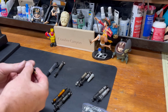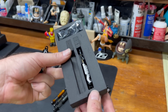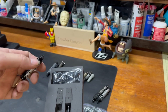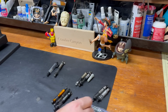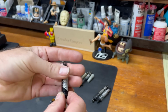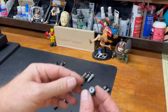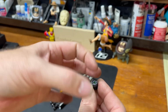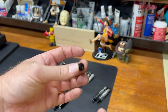And where does that Desert Lizard fall? The Desert Lizard is a shock that, when you buy the shock in the little package, comes with all the springs and all the different levels of pistons. The versatility of those pistons, we won't address that because they come pre-assembled. So the seal packs are pre-assembled under here. They're pretty easy to take apart. You see a little split ring, you just pop that guy and everything will come out. They come with replacement seals, they come with everything. So it's a full-blown cartridge shock.